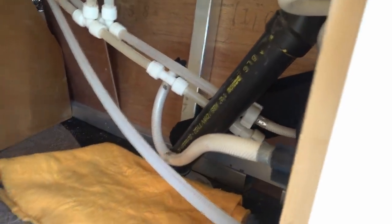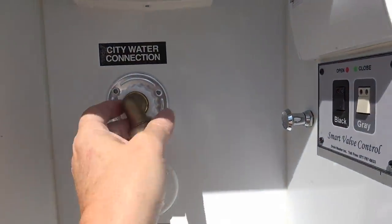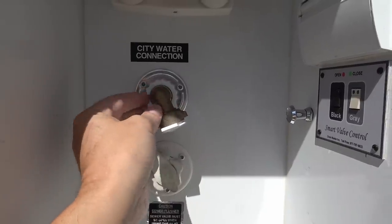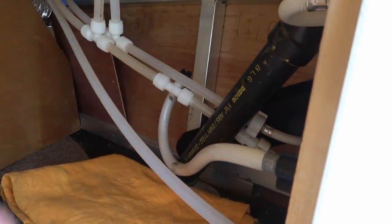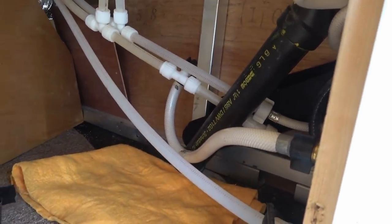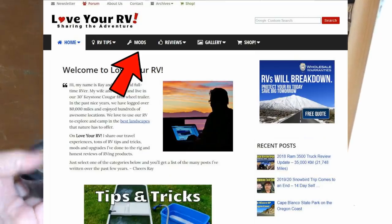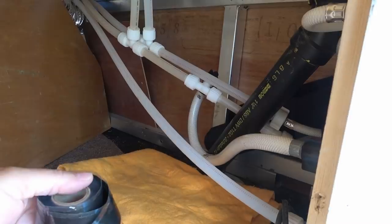Anyway, I'll have another repair project to do now — it's the way it is with plumbing. You touch one thing and all of a sudden another thing goes. We're all ready to go for our fresh water connection here. I think I'm going to go with the water pump for a while until I get that other hose repaired, just in case that other thing starts to leak. At least if I have the water pump running, I'll hear the water if it starts to dribble — I'll hear the water pump pressurizing more than it should. It'll run when I'm not opening any taps, so it'll alert me to the leak. If I just hook up the city water I won't know it's leaking and I'll end up flooding my basement. By the way, if you guys are looking for some mods or upgrades to do in your rig, I'll link back to my Love Your RV mod and upgrade archive — maybe you could get an idea of some things to pass the time with. Until next time, Ray from Love Your RV. Cheers everyone.